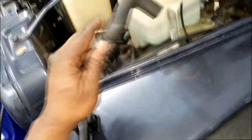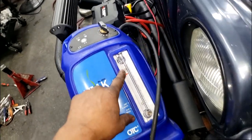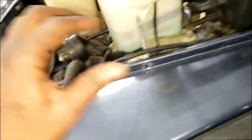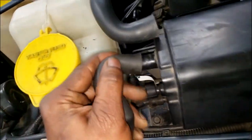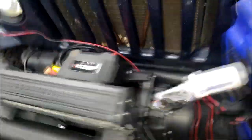The computer is picking up a leak so we're gonna play process of elimination. This is the heart and soul — the leak detection pump in the EVAP system. I got my leak detection pump right here, I got a hose right here. I'm gonna fill the system up with smoke and air and monitor right here how my ball reacts. Let's pull the main hose off of the vapor canister and put my test hose on here. I have my system plugged up. I need an air hose right here.